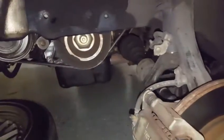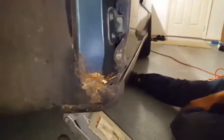With the roller, what it normally does, it'll roll this up so it's almost like a sandwich — pinched together. With the roller you can also flare out the fender so it'll push it out a little bit and allow more clearance for your wheels. One of the methods to keep the fender liner would be once this is tucked up, slip a zip tie through it and then to the connector holes. I've never kept fender liners on my personal cars, but you do end up with a lot more dirt in the engine bay and more dirt going into the door panel.